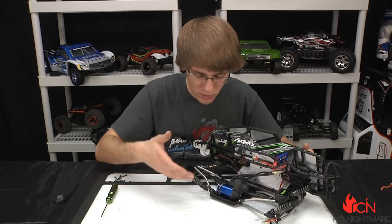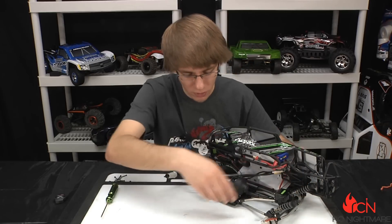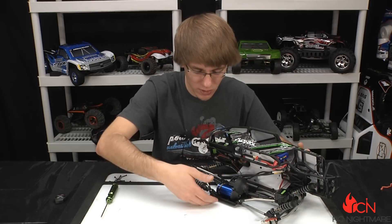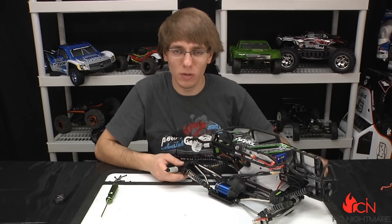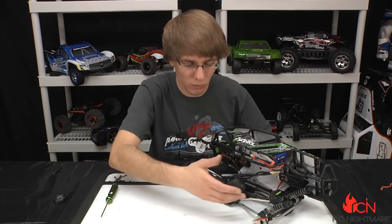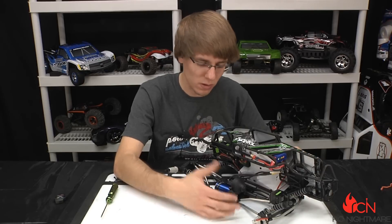So again, that's how you get easy access to it: you're removing one of the rear upper shock bolts, the two front ones, and then there are four bolts on each side of the center skid plate. That's gonna allow this whole unit to drop down and give you really good working room on it, and I'm not disassembling all the links or taking apart the body at all — really easy to get to.